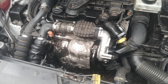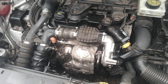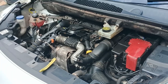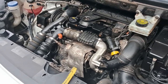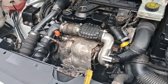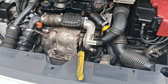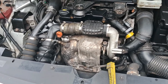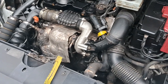It's all back together. I just started it up and it starts up fine. I'm going to give it a road test now and see if we've lost the whine on the turbo. Well, it's all gone back together. I've flushed the engine out with half engine oil and half diesel, had it running for about 10 minutes. It's quite a thin concoction but it's just enough to lubricate it, so inside that engine it's absolutely spotless now.